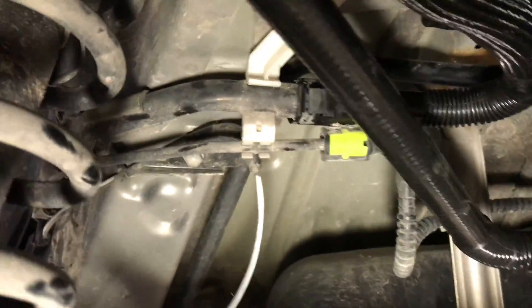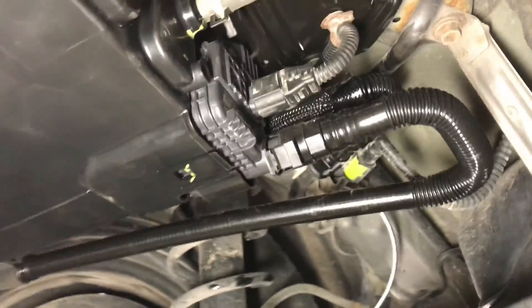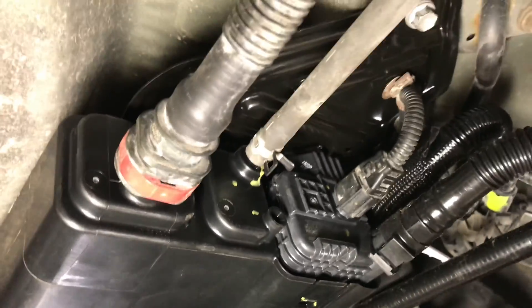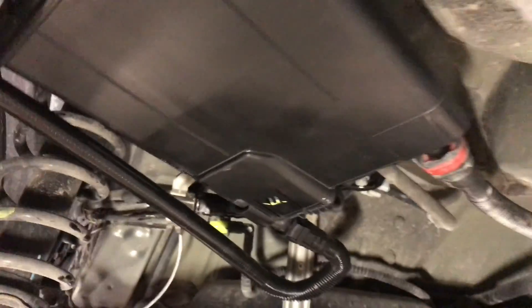Here's the charcoal filter and canister correctly installed. It's kind of hard to screw up because the pipes are bent the right way — one end goes in there and the other end goes back into the charcoal canister. It's just an inline filter, and all the other cables and hoses go into the same spot. I'm just going to clear the codes and run the car, and the code shouldn't come back. Thanks for watching.